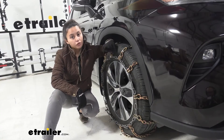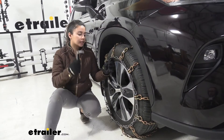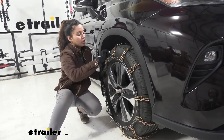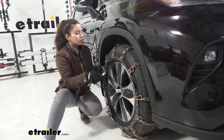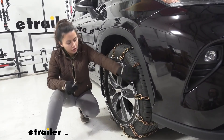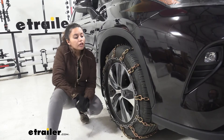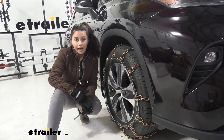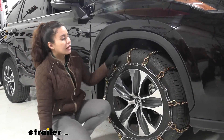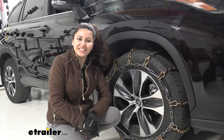This snow tire chain comes in two versions: with a cam and without cam. This version has the cam tighteners, which I kind of like. It comes with an included tool and this allows you to choose how much tension you have on your tire chain. We still have a little bit of slack, so let's try it with one cam tightener. I actually think that's enough — just one and you have enough tension. With this looking good, you can then install it on the other side as well, exact same process. After installing both, I do recommend rolling forward a little bit and then double checking if you have enough tension. If not, you can use the other cam tighteners easily, and after that you are good to go.